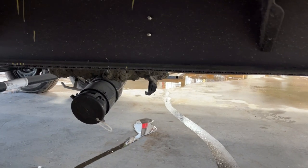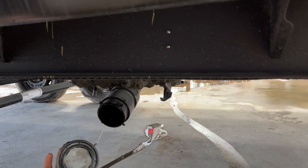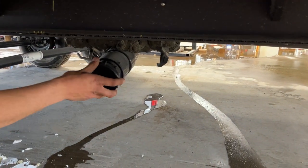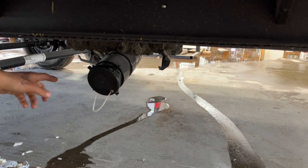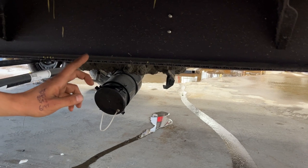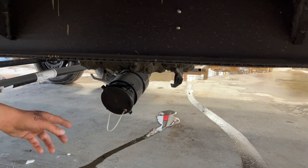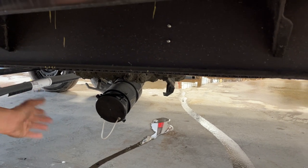Straight up on the frame from there, you'll find your sewer hose outlet. Press on that, give it a turn, and it'll pop on out. You can see it's got the same two ears on it that your sewer hose had — it'll attach the same way. On the left you get a gray valve, on the right you get a black. The black valve controls your black tank, which holds waste from your toilet — it's our dirtiest water, so we'll dump that first. Once that's done, come to the gray. The gray tank holds water from your sinks and shower — typically cleaner water — so we dump that last to keep the sewer hose as clean as possible.